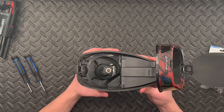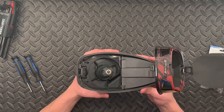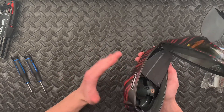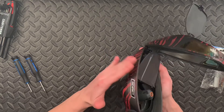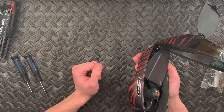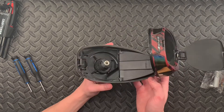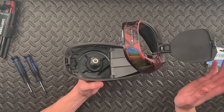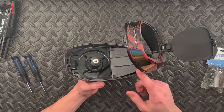The Spire works off of shot logic, so it senses the vibration off of every shot. So when I tap the Spire, it would register as a shot — nothing happens, it should spin. Now if you're having this issue and you're tapping it and it's not spinning, it doesn't necessarily mean it's the motor. It could mean it is the shot sensor.